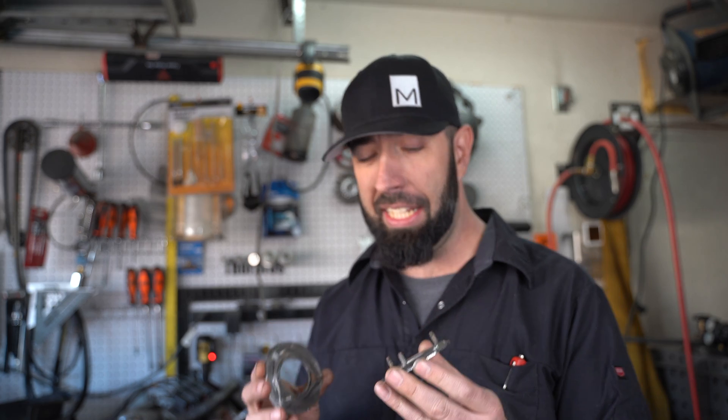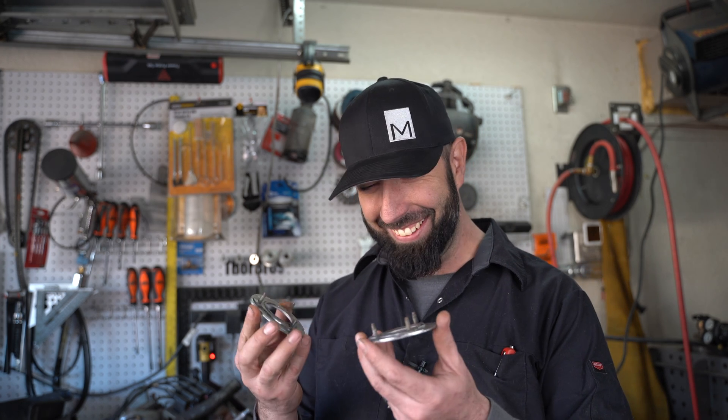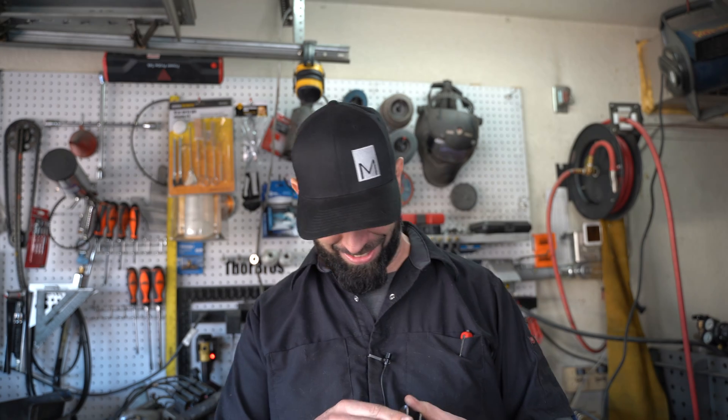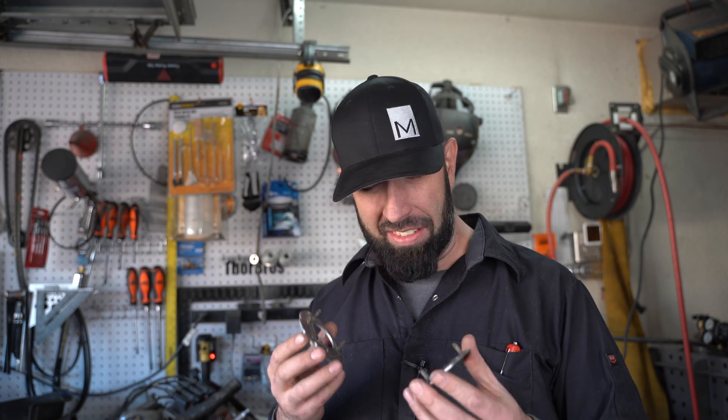There were two other bungs — or flanges, as I just remembered — in the Eclipse fuel tank. I cannot remember what they're for and I'm hoping I don't need them, but just in case I'm going to weld them to the top of the tank anyway, because once I line this tank with POR-15 I can no longer weld on it. If the flanges are already welded on and I discover I need them, all I'll have to do is drill out the hole. If I don't need them, it's going to look a little less clean, but maybe I can use them as some kind of fancy logo mount or something.